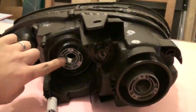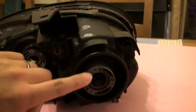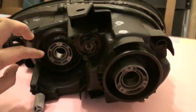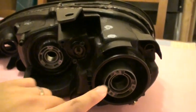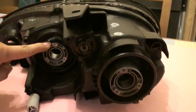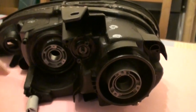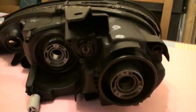The important thing to note is even though these holes look like they're evenly spaced, they are spaced in such a way that the ring will only go on in a certain way. So when you're screwing it on, make sure you turn it a couple times until the holes match up with the screws. Also, the screws on this side and that side look very similar, but they are actually slightly different. So make sure you note and save those little screws so you know which set goes where.